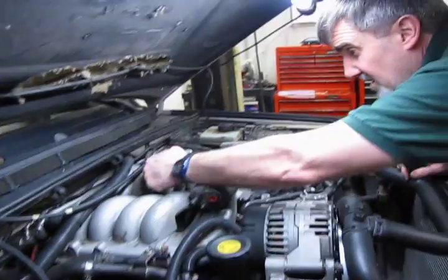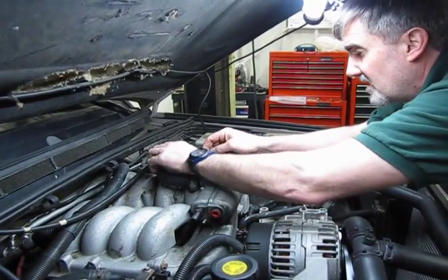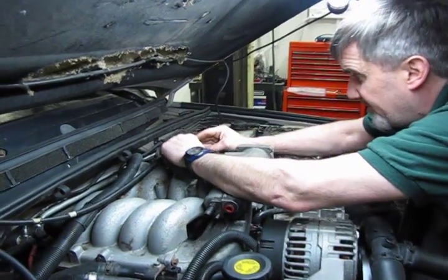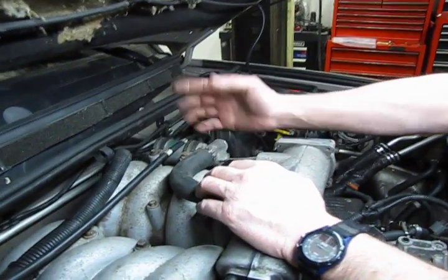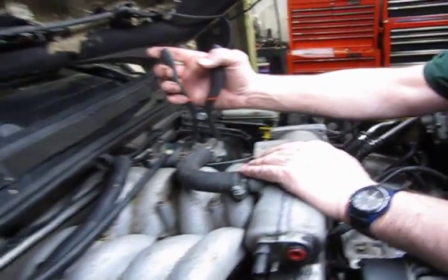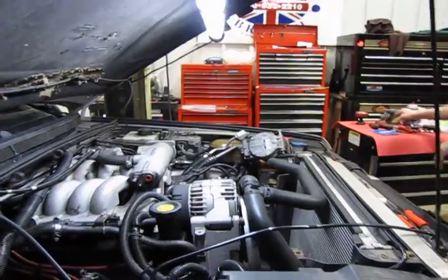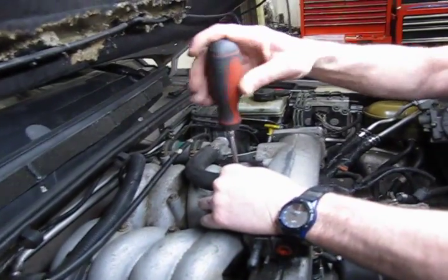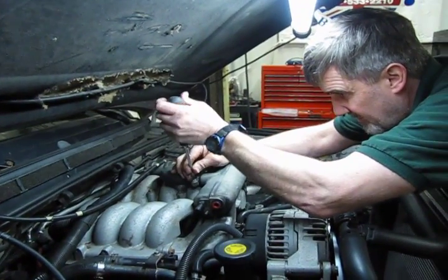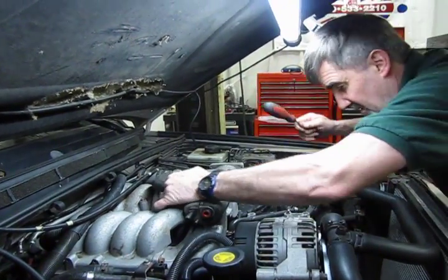So, alright, next step is we plug in our idle air control tube and set our clamps back in place. Now one nice thing about those little clamps that are a pain in the neck to unlock is they sort of make up for it by how easy they are to lock. We're just going to grab these two tabs right here and squeeze them together, you'll hear a nice solid click, and that clamp will be on. And there you go, and all the rest of them are going to go on like that. Alright, and that's good and tight.